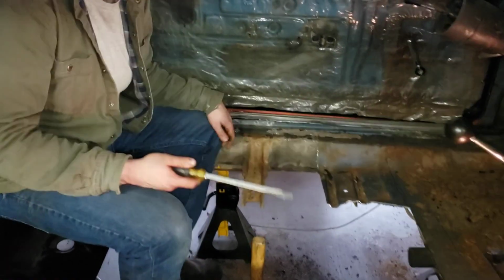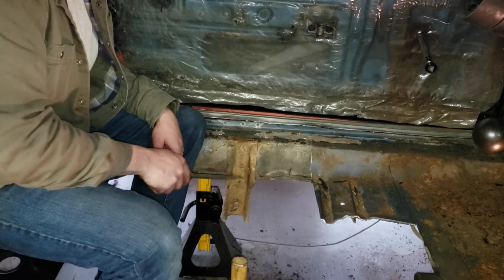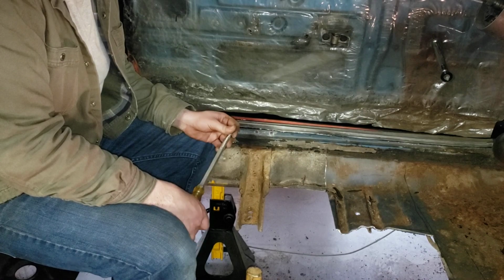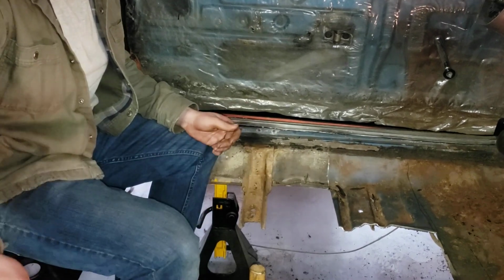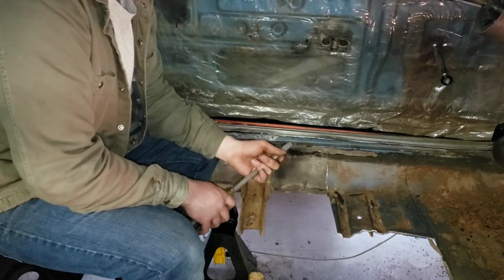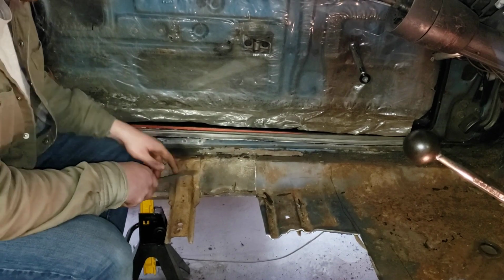We had a couple of issues doing this the way we're doing it. It just popped. This side had three spot welds. Seems like they're kind of inconsistent with where stuff is from the factory, because I know the ones on that side had a few more and they were staggered. This one just had three in a line. But we popped all of those welds, kind of worked it to snap it there.